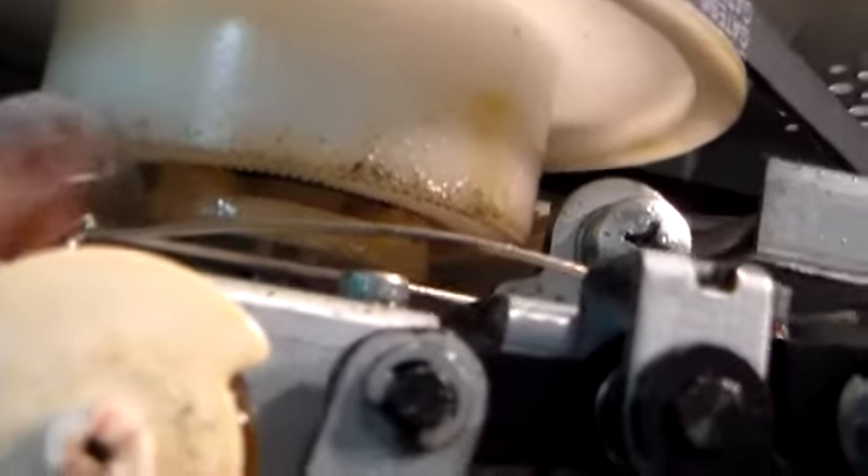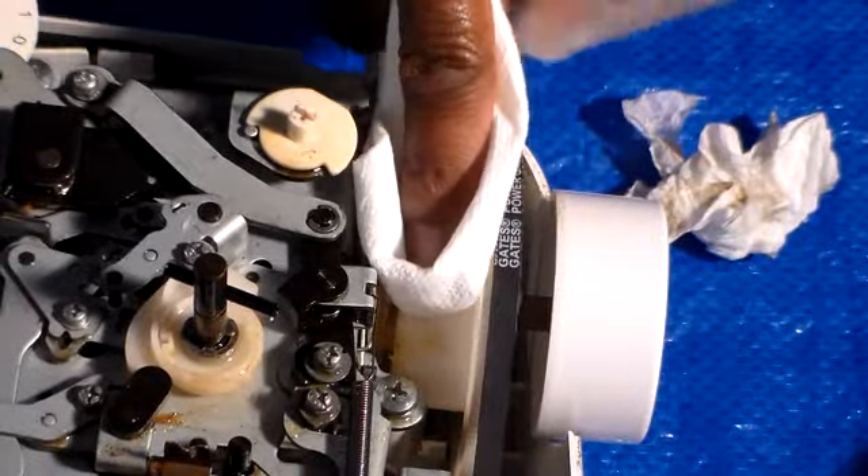So whatever this is making contact with at the bottom down here — it looks like I got oil on this rubber that makes contact with this spindle here. That may be a problem, so I'm going to get the oil off of that. I'm going to take some sandpaper and sand this piece of rubber — not sand it down, but make it rough — and we're going to check the contact and see if that's going to solve the problem.